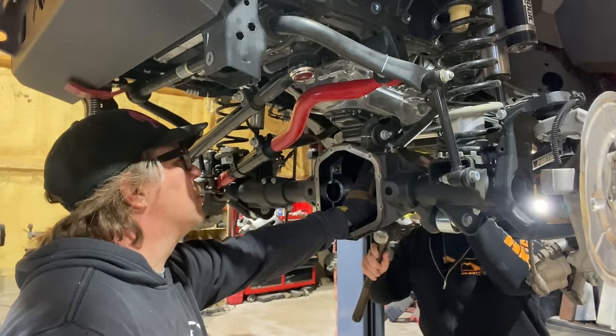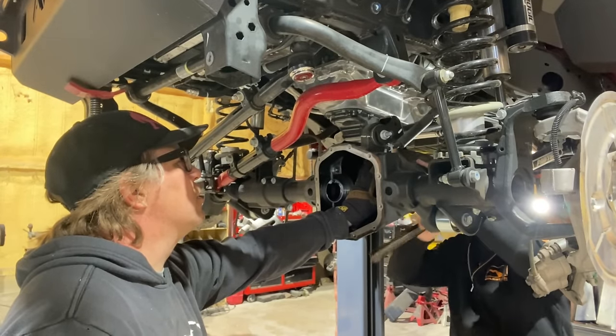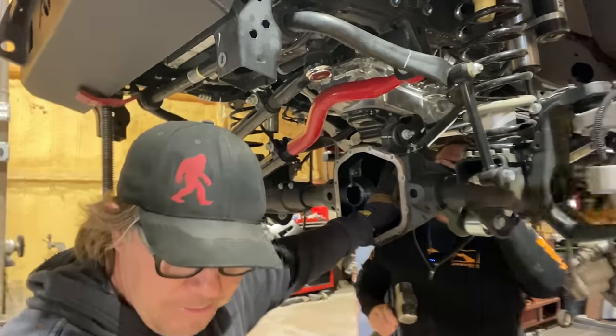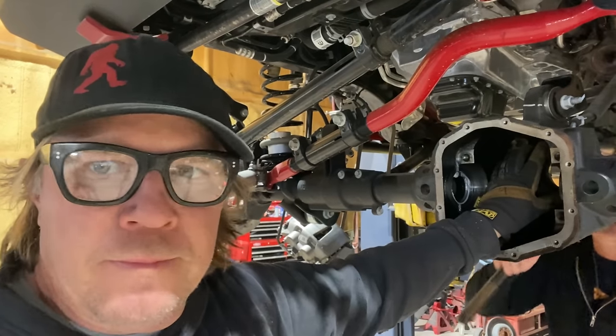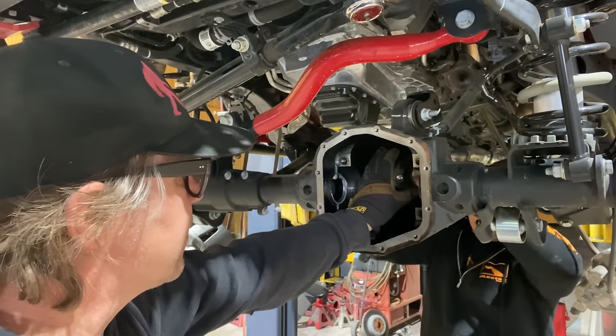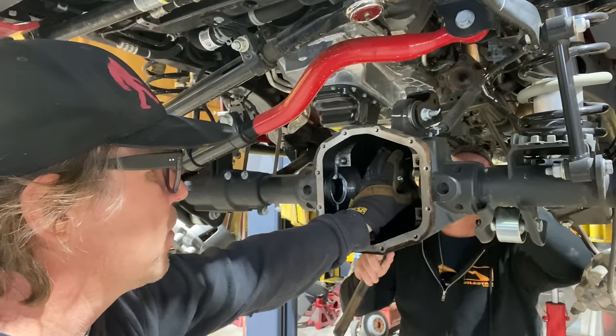But if we do, we've got a whole master kit with the shims that we need, and we'll just mimic what's coming out of here. And like I said, I know our gear for a fact will set up with an extra 5/1000ths in the front of this JL. So we're just right off the bat going to add 5/1000ths, put it all together, and run our pattern.